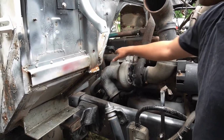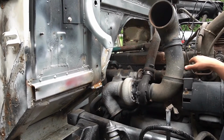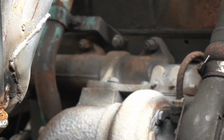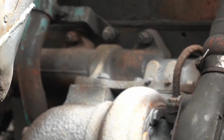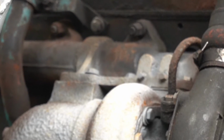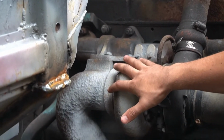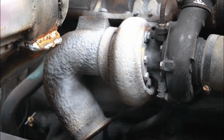So I also had the whole exhaust manifold out. The cool thing about this here is that it's a 3-piece exhaust manifold, so there's a middle piece and it actually connects to these other pieces here, which I think is pretty cool. Makes installing it really easy. I got most of the bolts out and put a bunch of anti-seize on it. Again, these things, over time, if they're just regular steel, they rust, and then you could actually break one off inside the engine, and that's really a pain in the ass. And I had to get them out so I could get the turbo out. Or actually no, I just got it out because I hate the rust. But it's all reconnected here again.